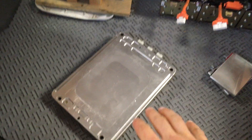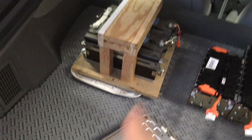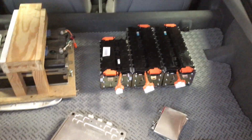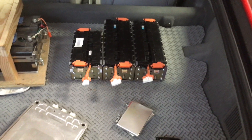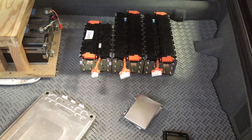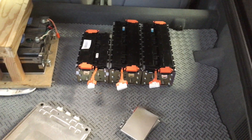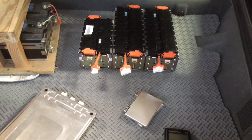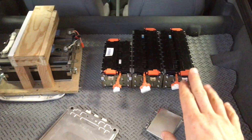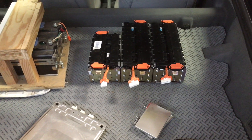The Leaf kind of fit but it was tough - there was nowhere to put the computers. This is the Honda Fit LTO cell, which you need three of. At the end of the day it definitely fits, which is super exciting - we have another battery option. At the $440 I paid, I'm surprised these haven't already sold out. It's really great to have another lithium solution for these cars. I still need to weigh these packs and I'll take the mechanical dimensions as well.